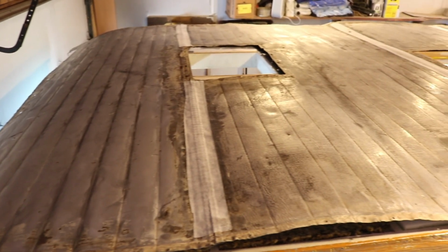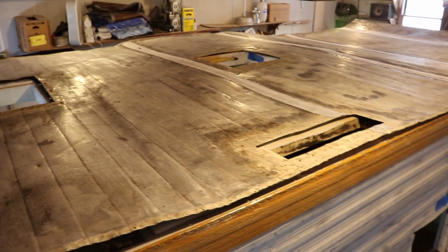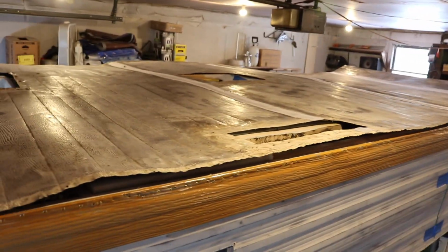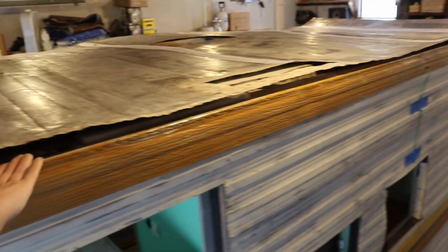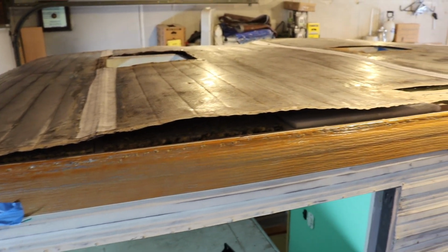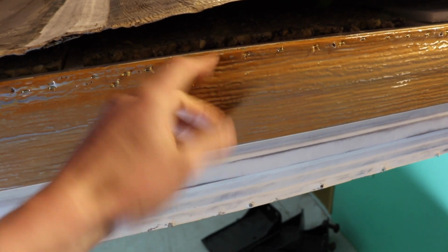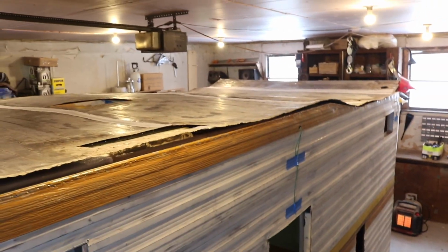And we have the roof on the camper. Nice. It's just laying up there, obviously, but it's for the most part all prepped. There's a few things I have to do. I gotta wipe down the underside here the best I can with naphtha. This edge will get scooted over and then capped, kind of folded over, and then in between that will be butyl tape. So I need to clean those two surfaces prior to the butyl tape for good adhesion.